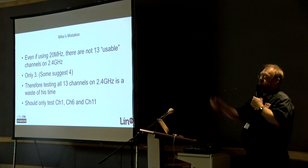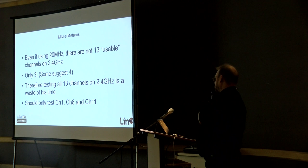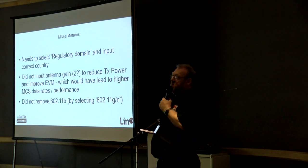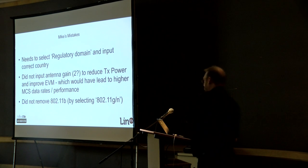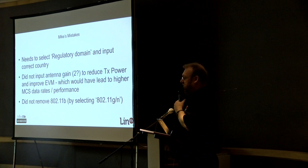On 2.4 GHz, when you change it to 20 MHz channel spacing — not 40 — it will open up the full set of channels. But you can't choose them all — you can only have 1, 6, or 11, because those are the only ones that don't overlap. They are four sets of 5 MHz apart. You also need to go into advanced mode — it's hidden until you press it — and once you click on advanced mode, you can change the country you're in. Set it to your regulatory domain: United Kingdom, France, Netherlands — wherever you physically are.